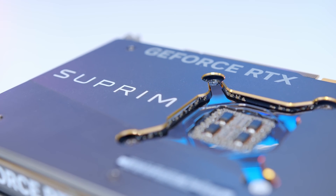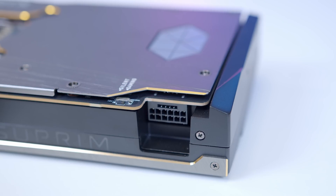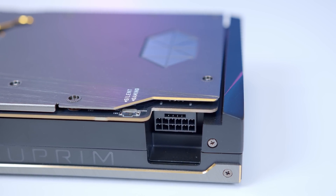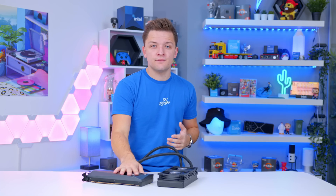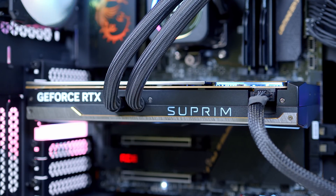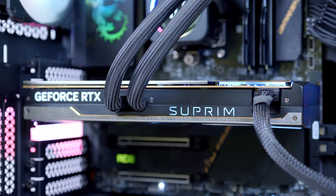It's built well, I like the design, and it uses NVIDIA's brand new power connector, which is digital over last gen and is capable of delivering up to 600 watts of power. The Founders design uses 450W; this is going to be closer to the 500W mark. But the only real way to determine if this extra power is actually of any use is to look at performance.